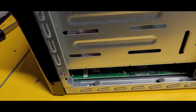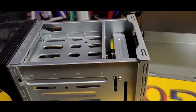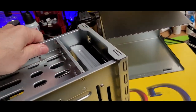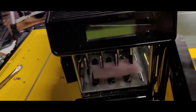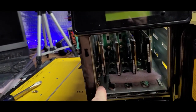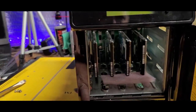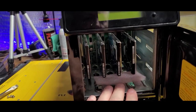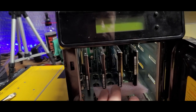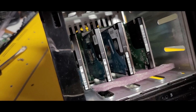So what can I do with this? I decided I was going to try to get it back in use again, but this time do it in a format that would actually do what I want — and that is house drives. If you look in here I have four 2.5-inch spinning hard disks: an 80, a 120, a 120, and a one terabyte. My thought was I could build this out, put in 2.5-inch old-size style hard drives. I have a kind of a gray area in this base design where there's a little bit of space on the bottom, but I'll put a spacer in there to better support these drives.